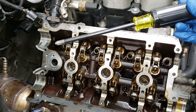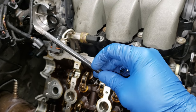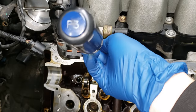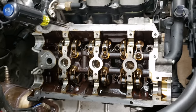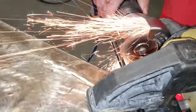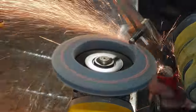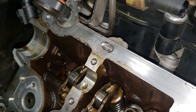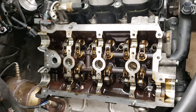So basically I'm going to sacrifice this screwdriver right here — this screwdriver fits just perfectly in the hole. I'm going to cut this screwdriver into four small sections and then round it off a little bit on the top, basically give us something to lock in here. So they'll at least be here and here so they'll at least marry together once I put the cam girdle on. Screwdriver, it's been real — thank you for your sacrifice, but I need head studs.